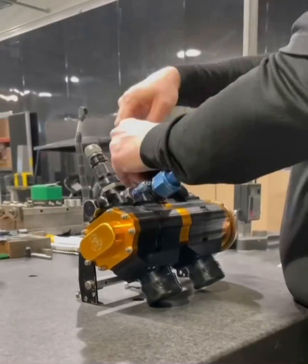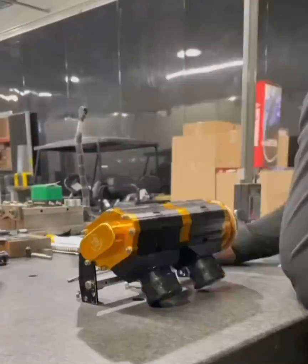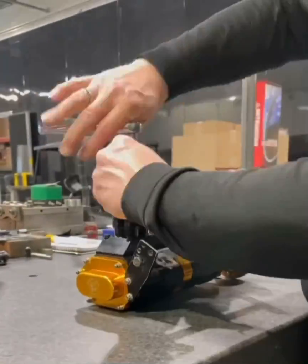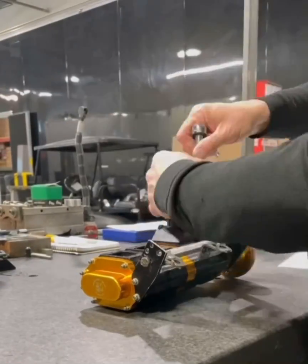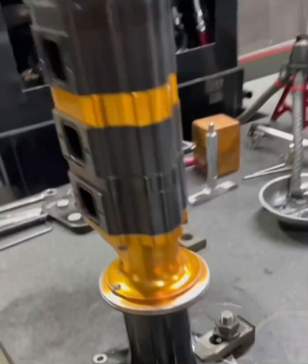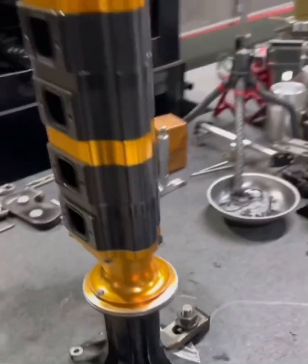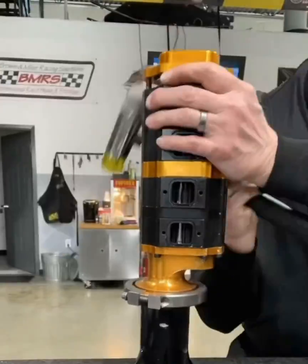Before I even get started on one of these things, the first thing I do is I zero all my indicators, make sure that everything is precise. Then I rip the manifolds off — the inlet and the outlet manifolds. Once that's done, I take a quick inspection of what this thing looks like inside. I did see a little rust on this one. The steam doesn't get out there that much, so I can see where that could happen. This is my setup for holding the fuel pumps. It's an old extension housing, and I just put that thing right down there on the old granite plate, and it's really nice and it holds the pump real well.